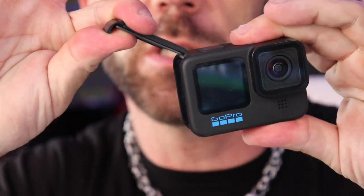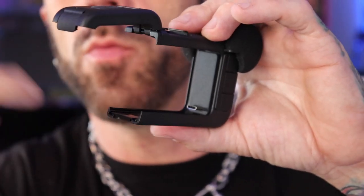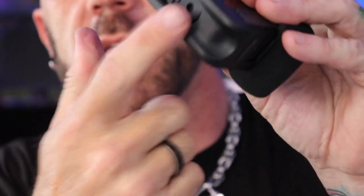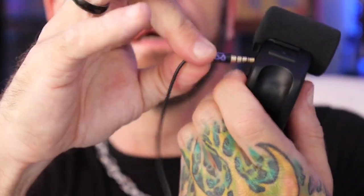Make sure you stay to the end of this video — I'm going to mention one other thing about the Media Mod that drives me crazy. For my setup, I'm using the GoPro 10 in the Media Mod. You do have to remove the door of the 10 to get it in and for the USB-C to hook up. The door is really easy to get on and off — just pull down like you're going to pull out the battery and push up on it slightly, not a lot of pressure, and it pops right off. Then open the Media Mod by pulling down on the tab and swinging the door open — it's on a spring. Line up the GoPro so the USB-Cs match, slide it in, make sure your feet are up on the bottom, and push it closed. The mic input is the bottom port with a little rubber door over it — just pull that out of the way and plug your microphone right in.